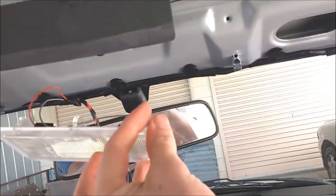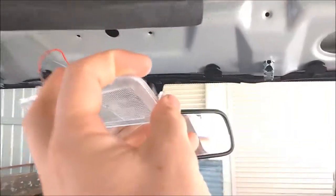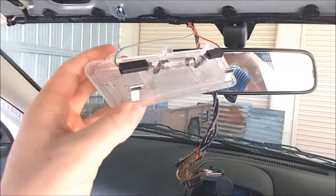This is the centre console interior reading light. It will come out with the roof panel and then you look at it from this way when you've got the roof panel hanging down - there are a couple of little metal clips on the back there, just push those in and that'll come out. You can just leave that hanging there as long as you're gentle. All the wiring is still live, so don't zap yourself and try not to short out any of the 12 volt positives on the bodywork because you'll blow a fuse or give yourself a little shock. 12 volts is fine, but try not to blow the bulbs.